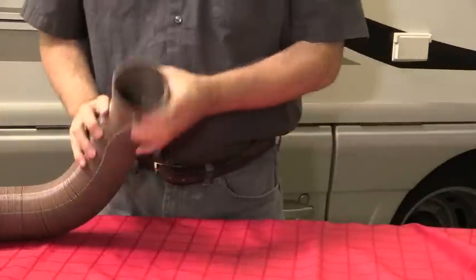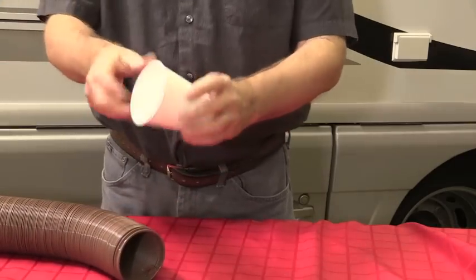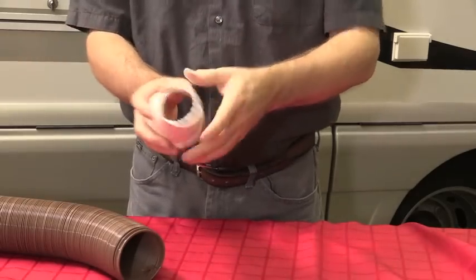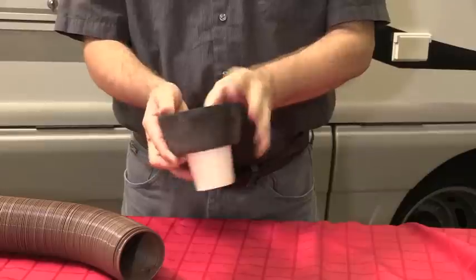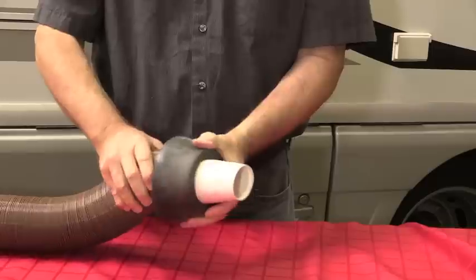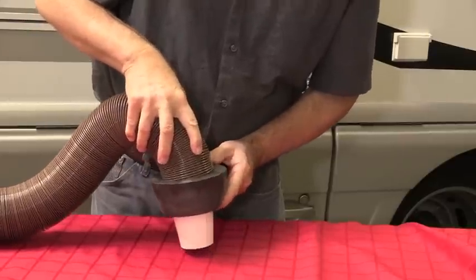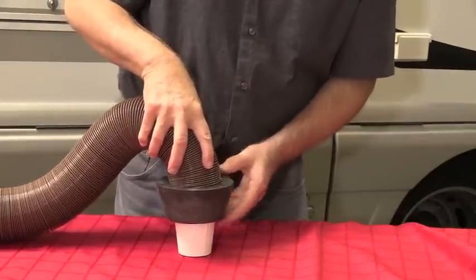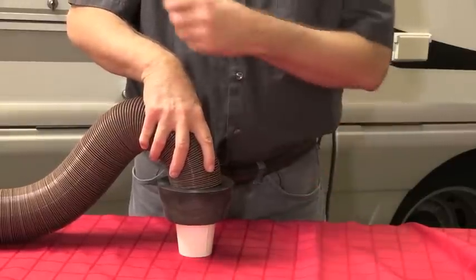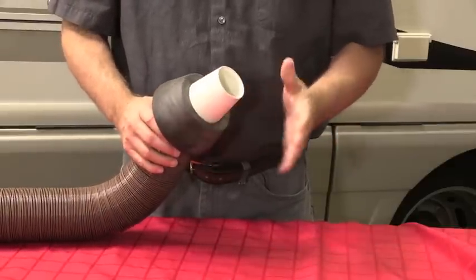But if you have one of these, what do you do if you get a narrow hookup? Here's what you do. You just need a paper cup — a Styrofoam cup works. You cut the end out of it, then you put it into your rubber donut, put the hose into the other end, make it nice and tight, and then this will go into the narrower drain. Now, you don't want to leave this here — it's not a permanent setup — but if you just need to dump your tanks and close them back up again, this is going to do the job. And it's a pretty cheap fix. So that's my tip for the day.